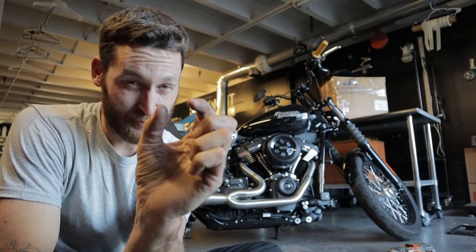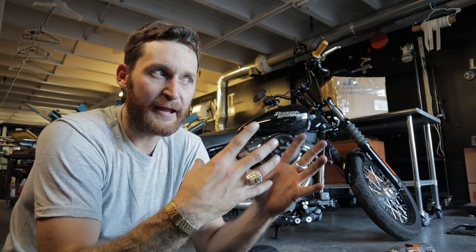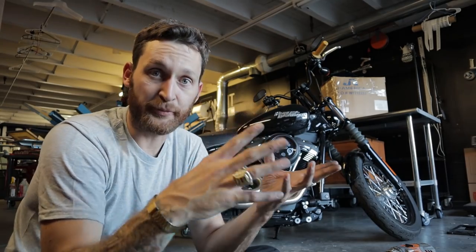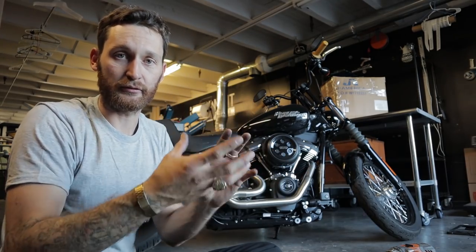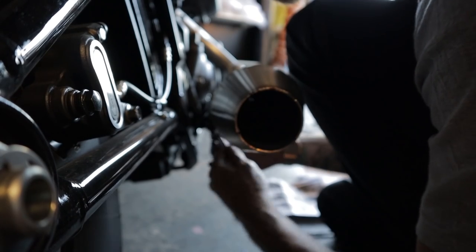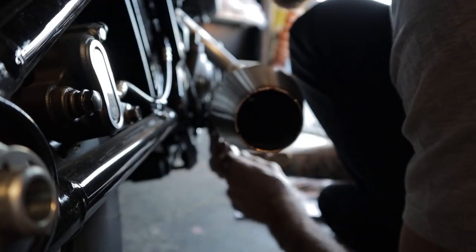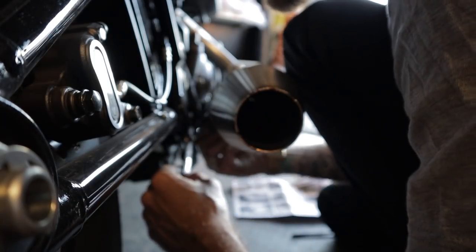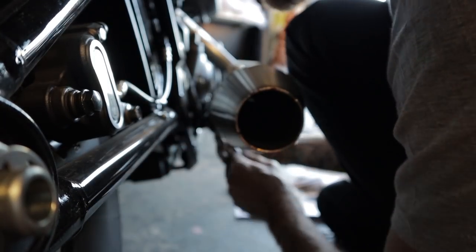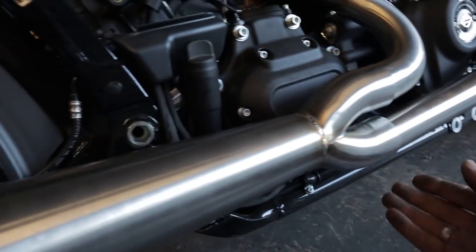It's only in there about an inch, if that. So it's kind of sitting in there. The fitment is not super precise. You kind of have to whittle things around, do a little jiggling, a little wiggling to get it to fit. Now you're gonna loosely thread the included 5/16 by 3/4 bolts onto the bracket to install the muffler. Now, this has a pretty ill fitment, dude. Like, this is barely in there, and so is this one.